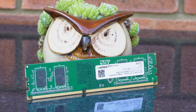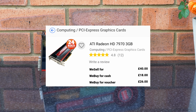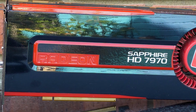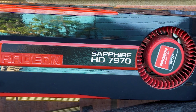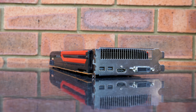After looking around, I opted for a Radeon 7970, which I picked up from CEX for £41.95 delivered. Now when ordering from CEX, there's no way of knowing exactly which card you'll get. If you're lucky, you might get a card with an aftermarket cooler, but the card CEX sent me is a reference design, and initially I was having some issues with it running a bit hot, but stripping it down, giving it a good clean and replacing the thermal paste sorted this out.